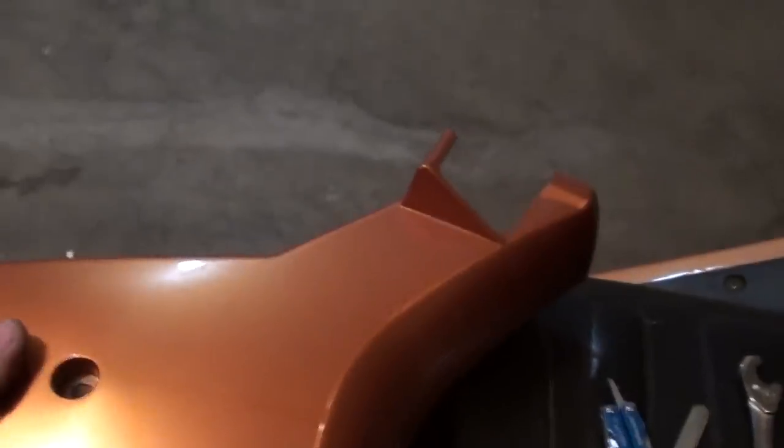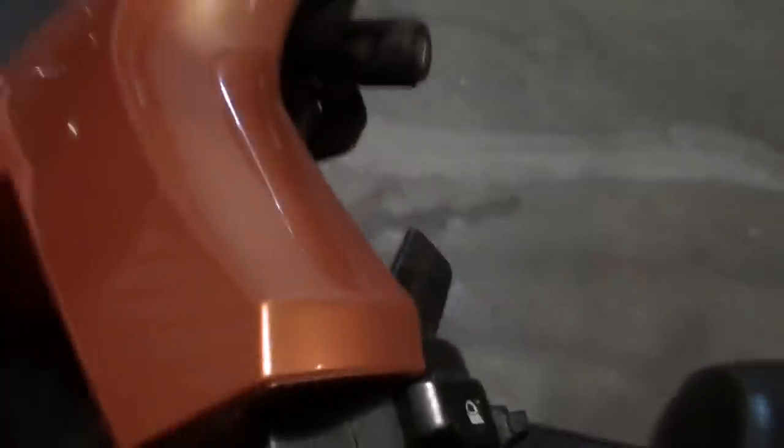Before we could remove the dash we had to remove this, which is by far the most complicated piece to remove so far. It has four screws and two bolts in it. This back section has to come off first, but the bottom part is the harder. It sits there — you have two screws on each side. You will need the key and probably somebody to help you hold it up, because you have to adjust the handbrake down to get to one of the screws.